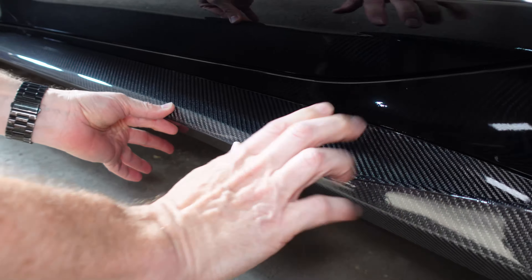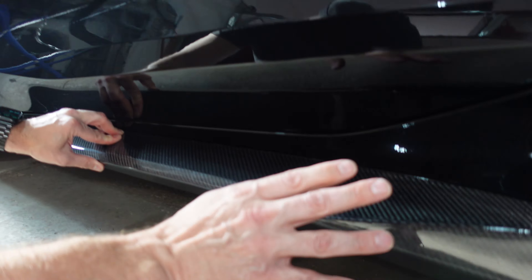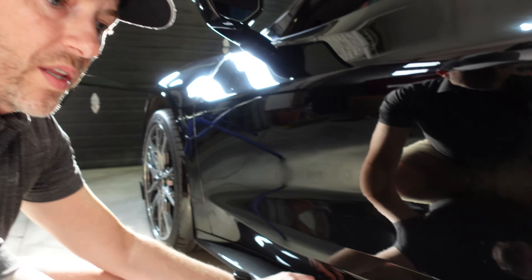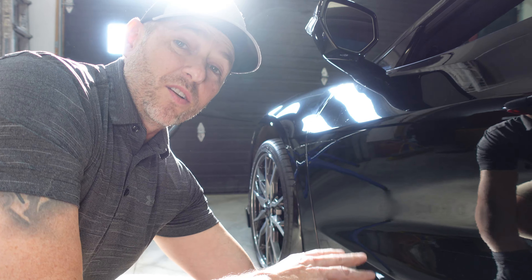First we're going to apply the adhesive. You're going to run it all the way along this big flat area and then down this edge. Make sure it's clean first and don't peel the backing off quite yet. I've already raised the back end of the car — it's much easier if you can get the car up in the air a little bit, so definitely try to do that. I have paint protection film all over the car including here, so the adhesive marring you see is from taking the previous skirts on and off — that's not damage to the paint. We're okay.